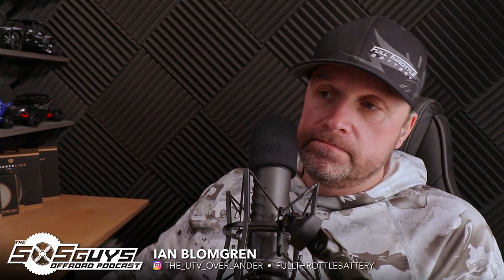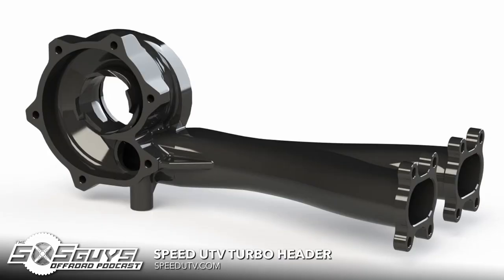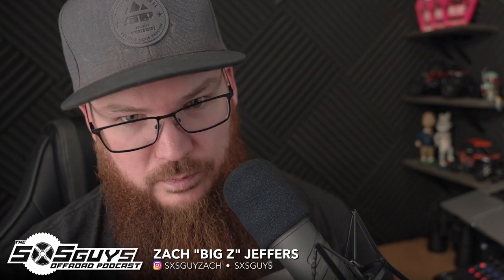It's eerily reminiscent of GYTR's turbo kit — the placement seems real similar to their setups. It's also very similar to what Robbie Gordon's doing with his engine, where the turbo is basically right on the manifold on the header and goes straight to the turbo — no piping around the motor like Polaris does. That gives you quicker spool-up, more pressure, faster spool, more power to the wheels faster. It'd be interesting if they're actually going to build one of those.